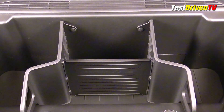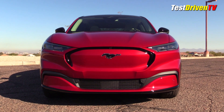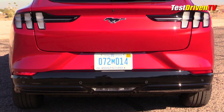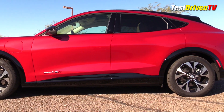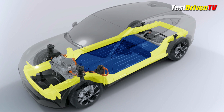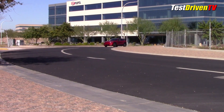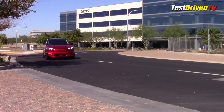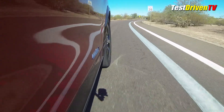But before peeling back all that plastic, let's take the larger view. The all-new Mustang Mach-E is Ford's first clean sheet of paper dedicated electric vehicle, meaning it didn't start out as a gasoline engine model and convert to electric. This means it's designed and built completely different. Looking under the skin of its unibody structure, we see that larger than average steel frame rails surround a large flat battery pack that sits entirely under the passenger compartment. The frame is robust because these battery packs are heavy and not only need to be held in place, but protected in a crash. This design is great for handling because it makes for a lower center of gravity, but bad because it makes the car heavier and taller overall — why it's a crossover instead of a sexy coupe like the regular Mustang.